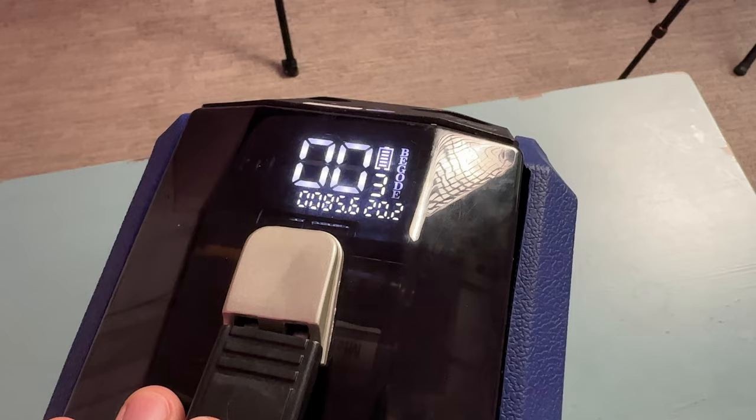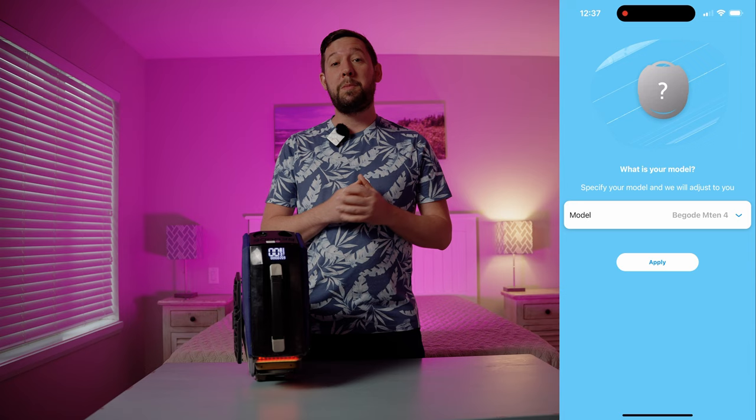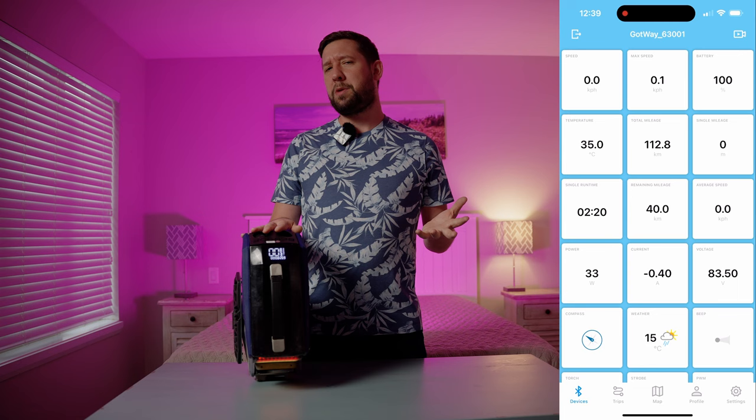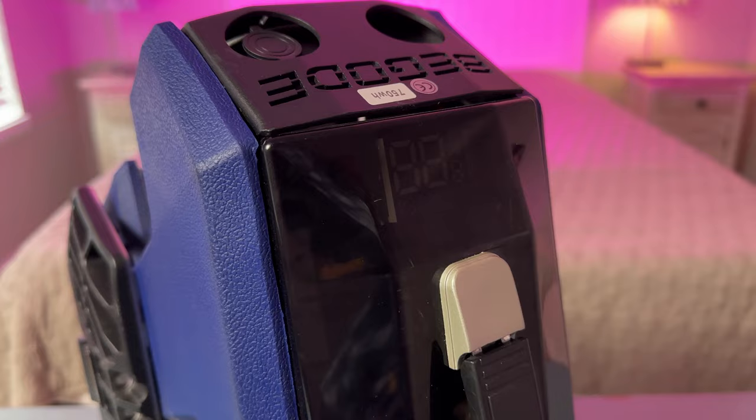Another great thing not found on many small EUCs is a screen. It's got a tiny little speedometer, odometer, and battery meter. The speedometer is one of the most accurate I've tested to date. The battery meter, however, leaves much to be desired — the whole battery calibration seems quite off, as it was still showing 20% remaining when it was completely unrideable, and there are only five bars indicated. I recommend using the DarknessBot app instead; you can set a range to around 40 kilometers and it will provide fairly accurate remaining distance. One major flaw is that the screen is almost completely unreadable in direct sunlight, likely due to the smoked clear plastic on top. But hey, it's better than nothing.